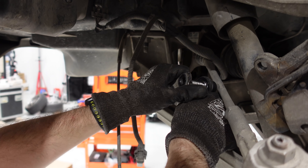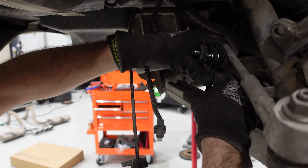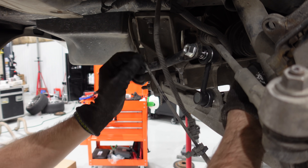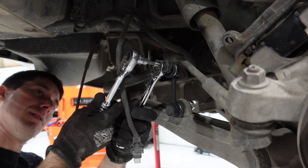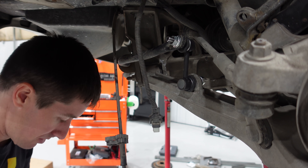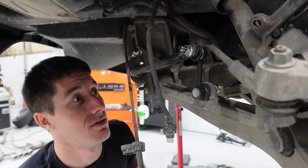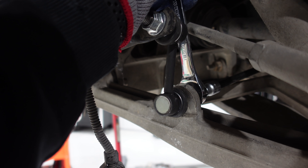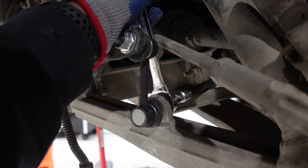It's going to be a little tight. I'm going to wreck my finger doing this. We got it. We can just toss our nuts on there and we're ready to change the shocks and bolt this whole thing back together. That's about as tight as they need to be. Let me get an extension in here — you'll need about a 12-inch extension so you can get your ratchet all the way into the corner. And that should wrap up the sway bar link change.